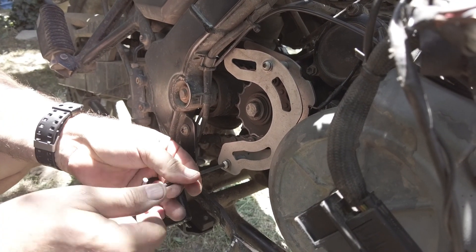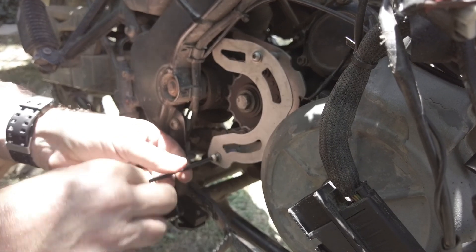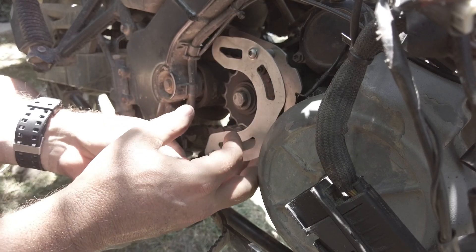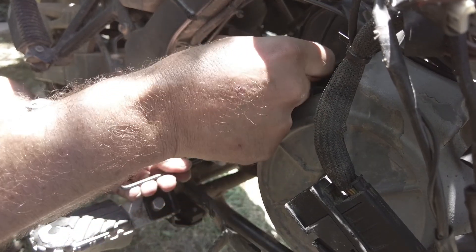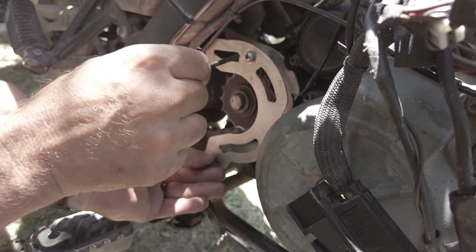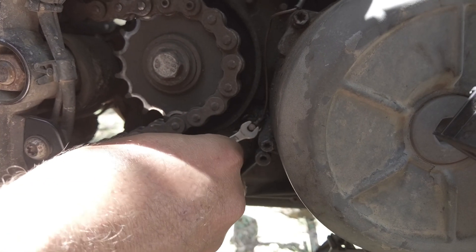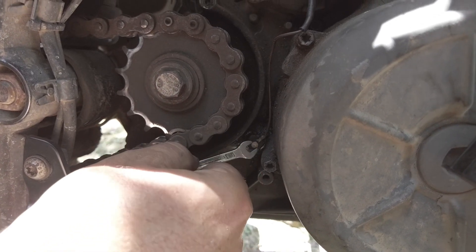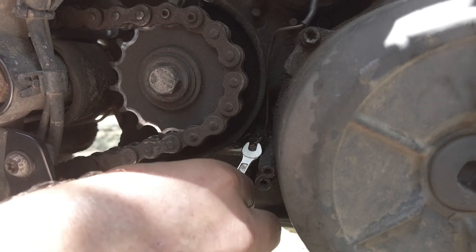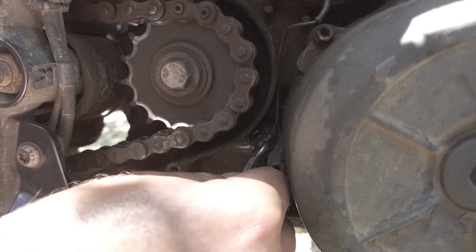This is specific to our bike — a Touratech sprocket cover; the factory one is plastic. But you're fairly certainly going to have to remove that cover in order to get the sensor off. It's a teeny tiny bolt — a 5.5-millimeter. I'm not sure exactly what the sensor is — I think it's for neutral, but not 100% sure. Either way, it does have to come off because it's part of the harness.